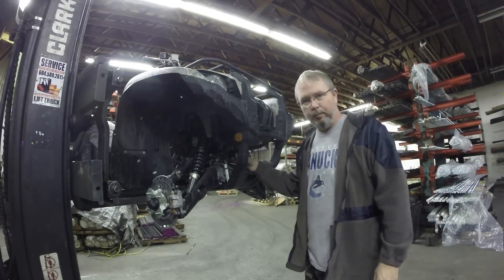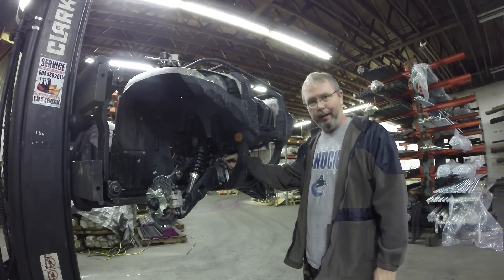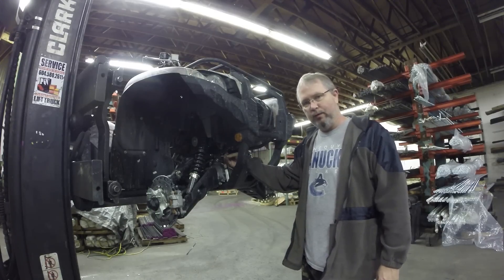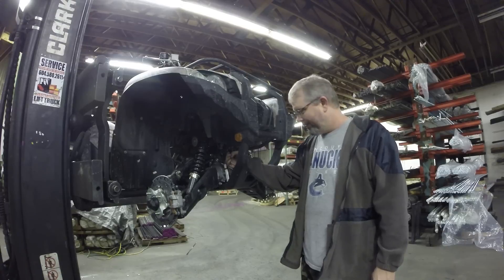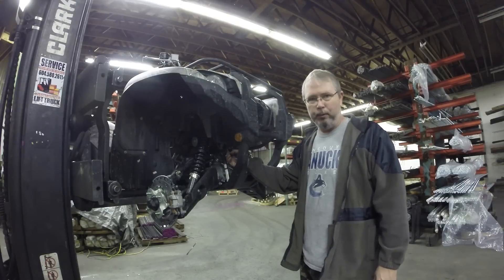I'm about to put the winch in. I just wanted to mention — I have pre-wired the power supply ahead of time, because if you don't, you'll find that you need to hire some small kid to get their hands in here to hook these up, since there's not a lot of room after you have the winch installed. Best to slide the winch in, hook it up, then bolt your winch up.